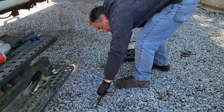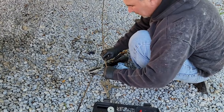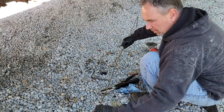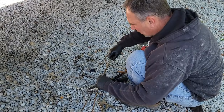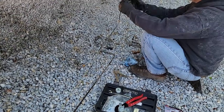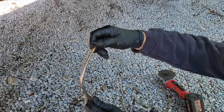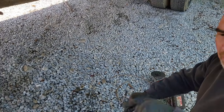I'm trying to straighten out some of these bends in this line, because this is a line I've used from a truck we took apart. Someone had just put it on but there was a bunch of compression fittings, so I just pulled them out completely because they had splices in them. We're ready to put this in — I just reused the original nut. You can see it's a 9/16 head but still a quarter-inch flare. So now we're going to send it through and get it on.